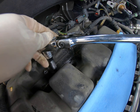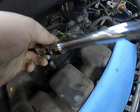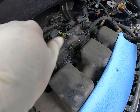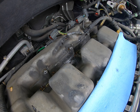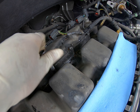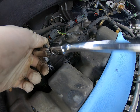Now for the actual spark plugs. I'm only going to show this rear part since I've split this into a two-part video. But obviously, once you get here, it's easy for the most part — unless you're in the situation that's about to come up where something is inside there and it doesn't allow you to get the socket to sit correctly on the spark plug. You'll see in the middle cylinder — a piece of the spark plug broke off.